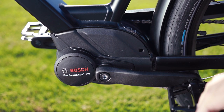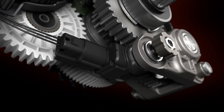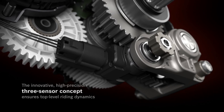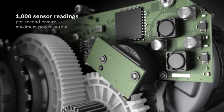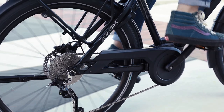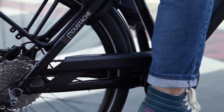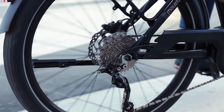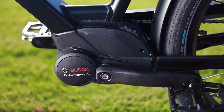The Bosch system works on a technology called Pedal Assist — you pedal and it provides assistance. There are three different sensors that make this work. Inside the motor there's a sensor that measures how fast you're pedaling, and another sensor called a torque sensor that measures how hard you're pedaling. Beyond that, there's also a speed sensor using a magnet on the rear wheel measured at the rear chainstay that tracks how fast the bike is going overall. Based on all this information, it takes a thousand sensor readings per second and provides assistance proportionate to what you request — anywhere from 50% up to 300% assistance at the top level.